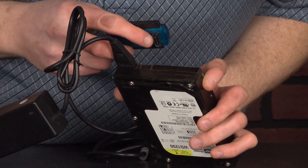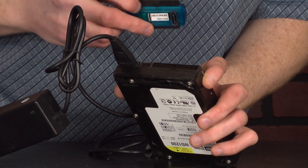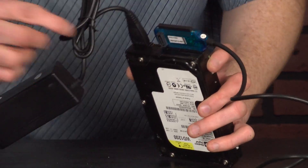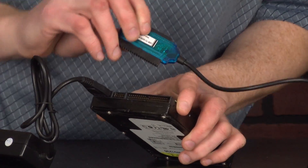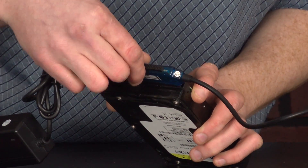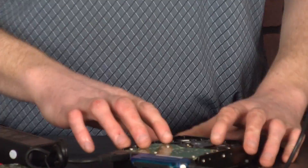You're going to go ahead and take the desktop side. You'll notice there's a little keying here — two rows of pins but one set has a pin missing, and that is going to correlate on the desktop side of the cable to a pin missing on this. You're just going to take the desktop hard drive connector and push it right in. You can see the cutout is right there. When you press it in it's going to go straight in, each one of those pins lining up. And now you have the hard drive connected.